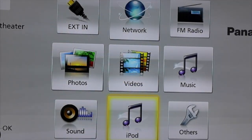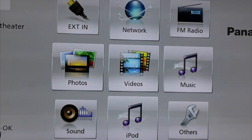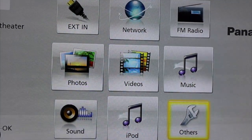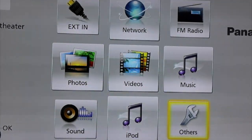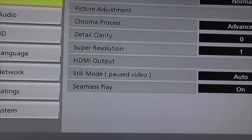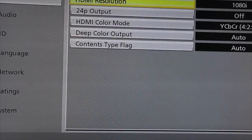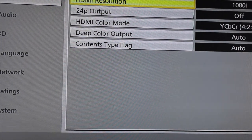One important setup on the Blu-ray player: if you're watching a movie and you want to watch it in the bedroom without disturbing anybody in the living area, but you can't get any sound out of the TV in the bedroom — go down to the little wrench where it says Others, select OK, then select the wrench in the middle where it says Setup. On the Video screen, go down to HDMI Output. Make sure it's not set to Auto Resolution; make sure the HDMI resolution is set to 1080i.